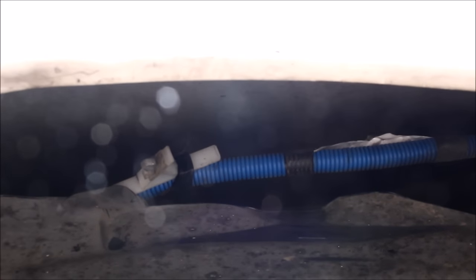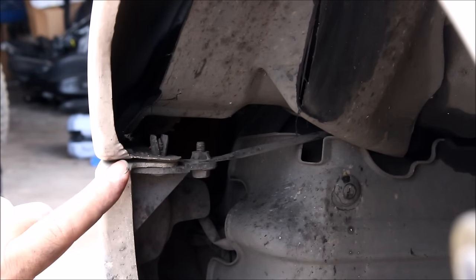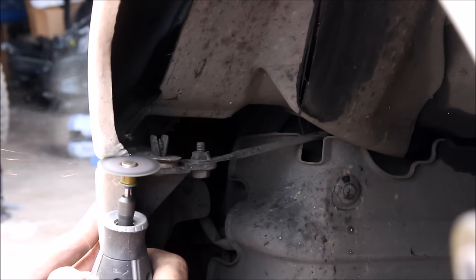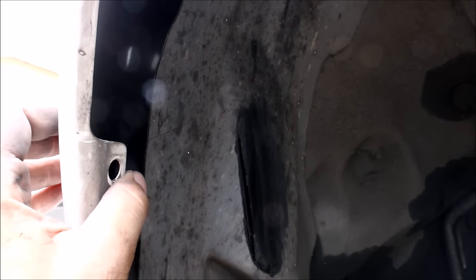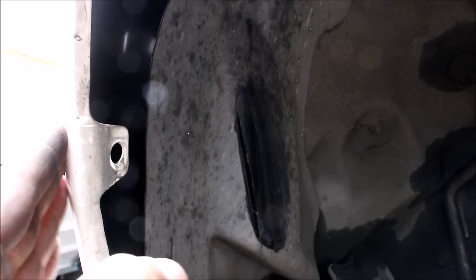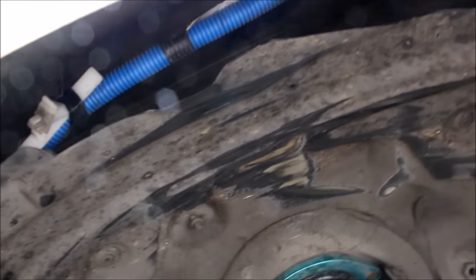You want to be concerned with wiring harnesses up here — usually you have to zip tie them pretty high to get the tire not to rub on them. If the tire rubs through the harness, all of a sudden you've got a headlight and a blinker that don't work. Before you start rolling, you want to make that same relief cut in the front that we made in the back. For most Miatas trying to get aggressive fitment, this tab area is usually a big problem and we're going to have to cut that later. I personally like to cut the tabs off because with the tab in place it can make the outside of the fender have a weird ridge or bump after it's rolled.